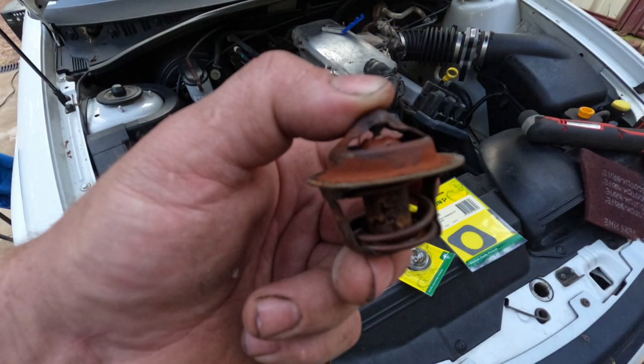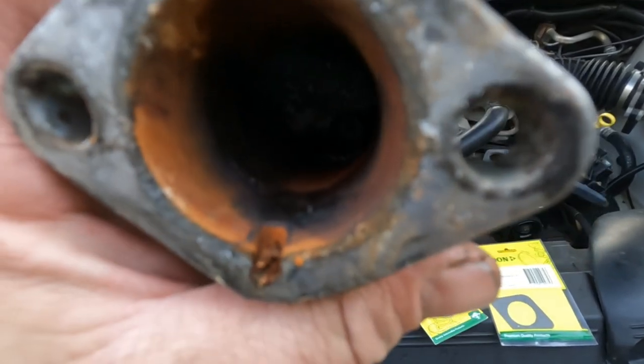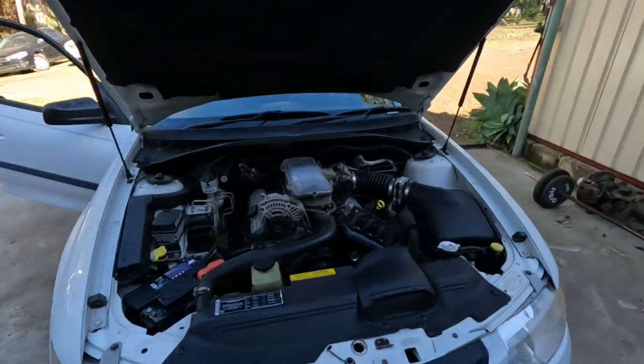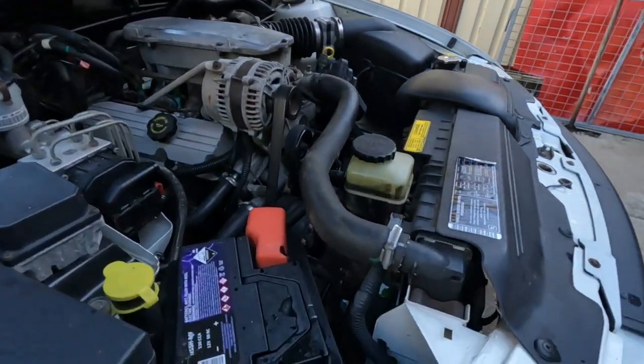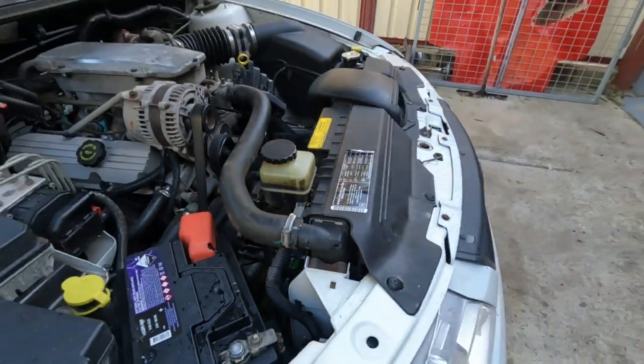Last night we started it up and ran it for a while and everything was going pretty well. Then talking to my mate Daz I thought we probably should at least change out the thermostat. I pulled that apart and found there's a little bypass hole in the thermostat housing that was blocked, and the thermostat didn't look the healthiest. So I just replaced it this morning and ran it up. Everything's going sweet - I just got to replace one hose clamp as it's leaking there, but for now that's pretty good.